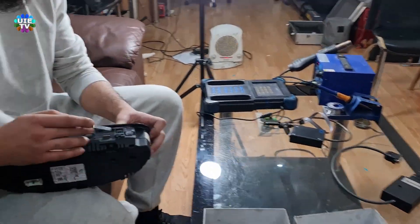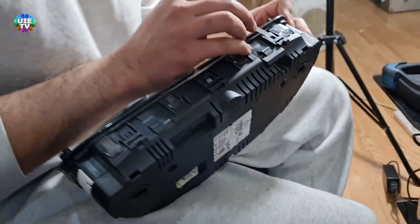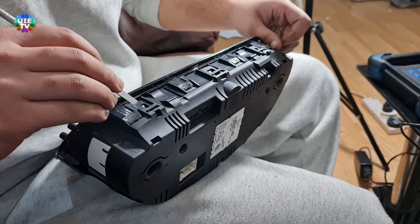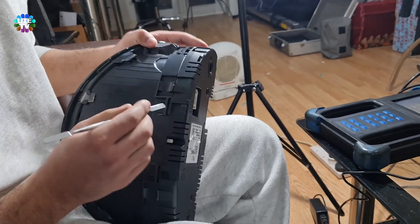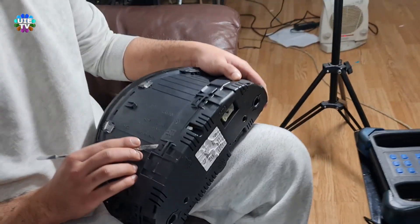It's very important to adjust the same mileage on the key module at the same time, because if you just adjust or correct mileage on the speedometer, the key module will send the original or previous mileage to the speedometer to override. I have already uploaded another video showing how to remove the speedometer and key module of this vehicle easily — the link is below in the description.